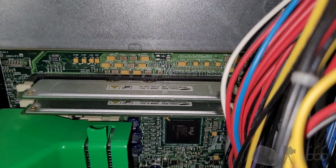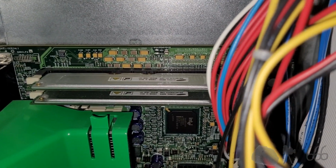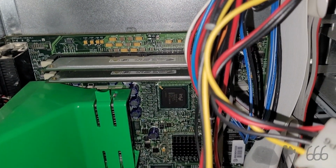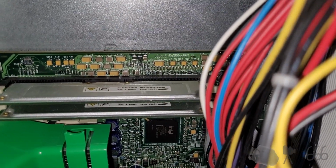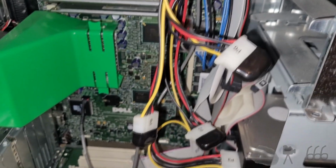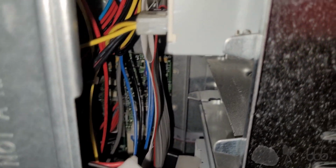And I mentioned the video RAM there. And of course, the RAM bus, which I have changed. This is a different set of RAM bus, RDRAM, than what was in here. The one interesting thing about this particular Dell, the GX200, as opposed to pretty much every other RAM bus system I've ever seen, there's only two slots. I've never seen another RAM bus system with only two slots. Usually they have four. So, I'm not sure if that was cost-cutting, if this was a lower-end model, or what's going on there, but that's kind of disappointing to only see two slots, because that really limits what you can upgrade this to, because, of course, there's only so much money you can really spend on RAM bus before it just becomes uneconomical. It's really too bad that they were the way that they were, but I'm glad SDRAM won out over them, if they were going to be like that.